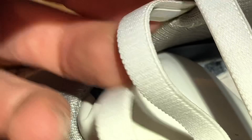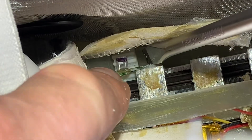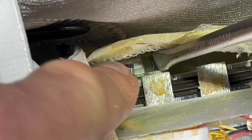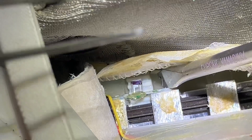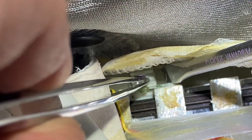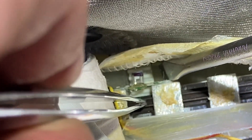I've then got the lace here which has the sensor in it, and that has now gone through and is sitting in the right place — sitting in between the two switches. You can see the top switch just there and the other one right underneath it. I had to use long tweezers to lift the lacing up a little bit and rest it up against the brown mechanism.